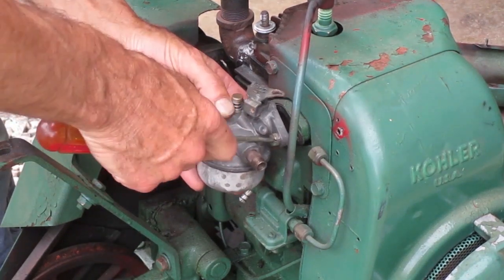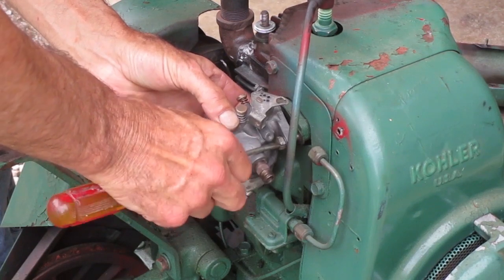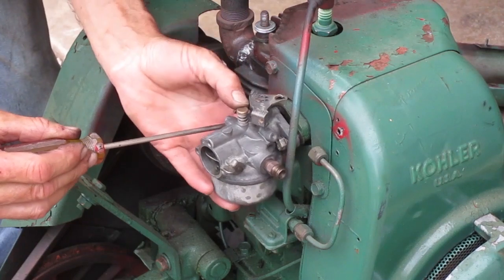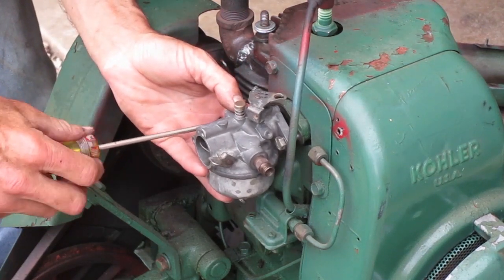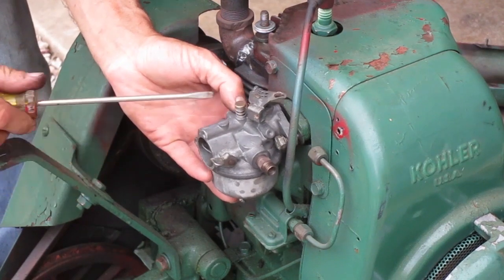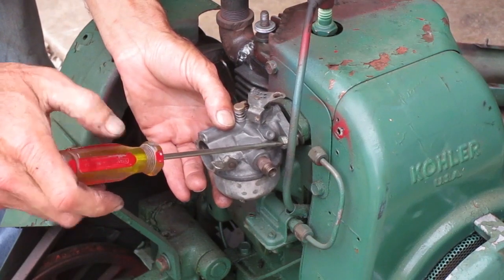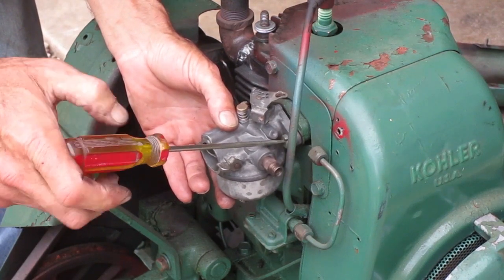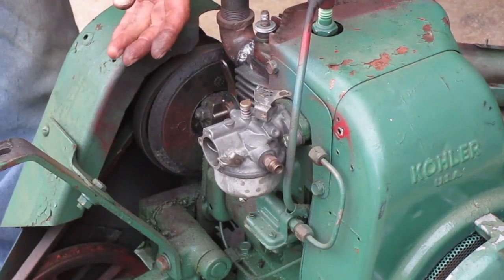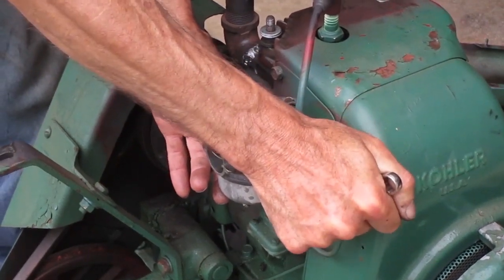The carburetor bolts on these old Kohlers had slots in the top, so you could use a screwdriver. There's no room for a socket. If you use a wrench, you can only turn them a little at a time. Use a screwdriver with a small tip so it can be on more of an angle without binding. And then you gotta switch to the wrench to tighten them properly.